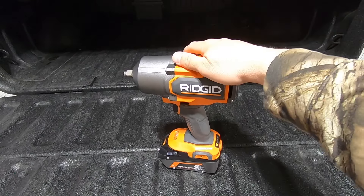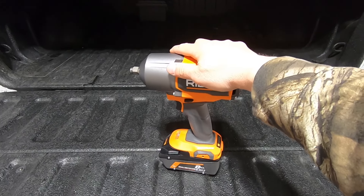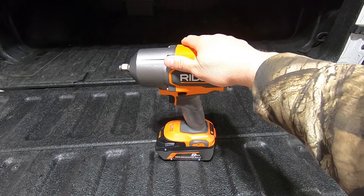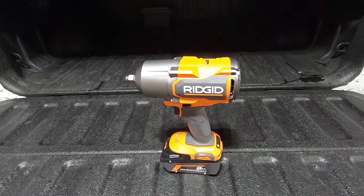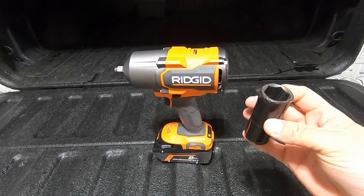This is one of those tools that's super handy for any sort of automotive work. Definitely get yourself a half-inch high-torque impact wrench if you can afford it, because it's going to be able to tackle a lot of jobs. One important thing to mention: when you are using cordless impacts or really any impacts in general, make sure you're using impact-rated sockets.